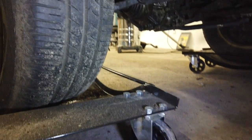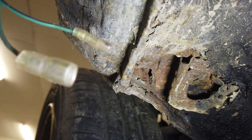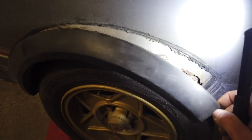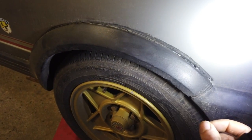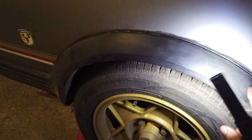In the bottom of the car, we have a problem area right there that I need to fix. The rocker on this side seems to be pretty good. Back here, we have found some rust as well. I'm just going to fix this as best I can by bending pieces of metal and welding them in. I'm not going to change the entire wheel arch because it is hidden, so it doesn't have to look perfect, but I would like it to be better than this.